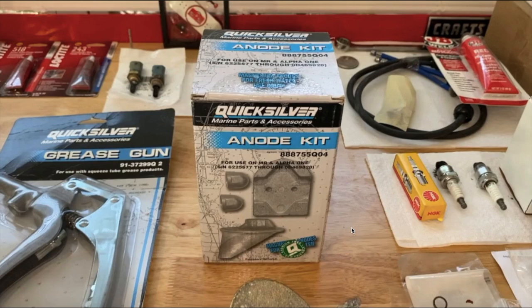It's a picture of the Quicksilver anode kit showing the part number and the anodes. Both circular anodes go on either side of your transom — one on starboard, one on port. And to the right of that, the larger block anode, which is your transom or bell housing anode. That is secured on the very bottom of your transom and mates with your hydraulic system distributor that both starboard and port hydraulic lines feeding off your trim rams are secured into. Below that, you have your cavitational plate anode — on the furthest outward or aft portion of your out drive.